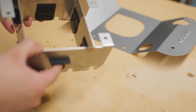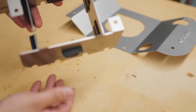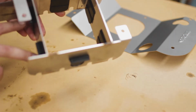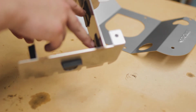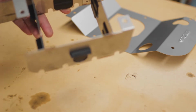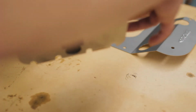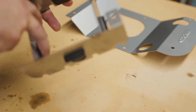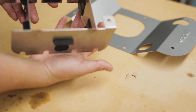So you can see if you do a hard left as well, oil will start to swoosh that way, but then it would come in through here, but it won't escape out of this side. Same thing if you're doing a hard right, vice versa in a way. The oil starts to come this way. It won't go through these, and it'll let oil through out of there.